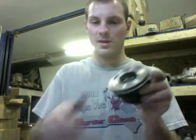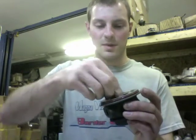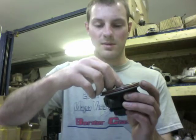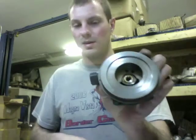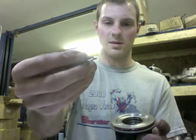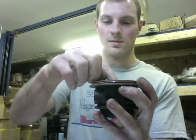Go ahead and put some oil in. I always clean all my parts really well before I install them, so I already cleaned them before starting this video. Put the front bearing in and make sure it spins well. Then you're going to put your thrust collar in with the flat side down — that's the part you have to grind the bearing housing to fit properly.